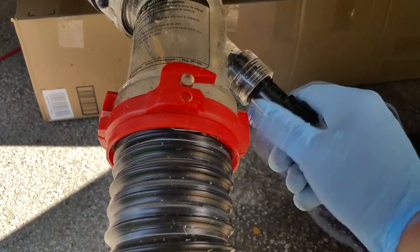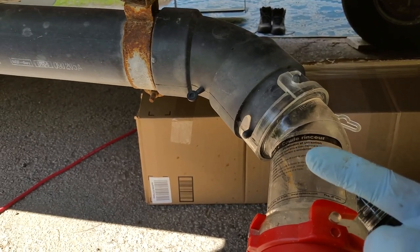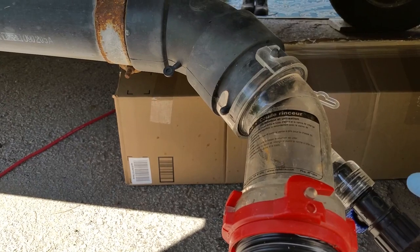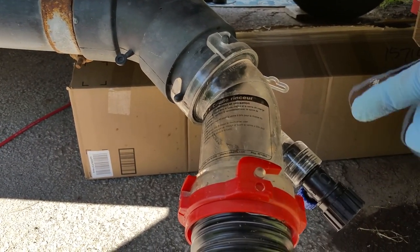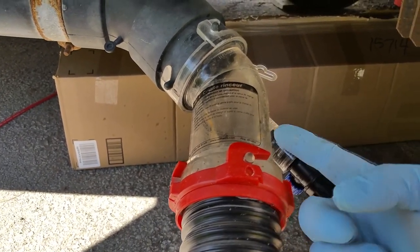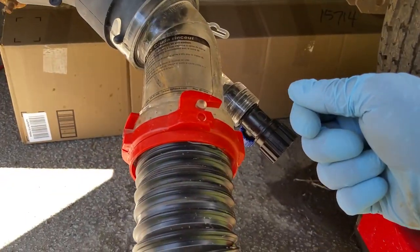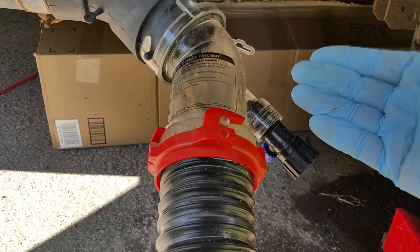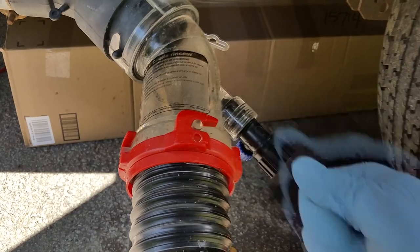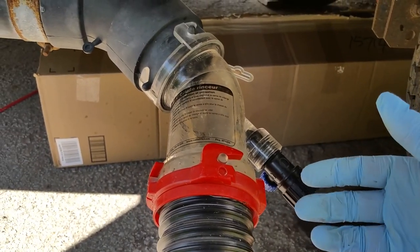Then this just comes out — you drill up there, push the snake up. I had to go around a couple of bends, as you would in all fifth wheels with the toilet mounted up in the front. In other trailers, the black water tank is typically right below the toilet, which makes this process easier. I had to twist the snake a couple times to get around corners. Once I thought I was in the tank — you have to sort of do that by feel or measure how many feet back — I would just push the snake in and out without twisting, because I was afraid it might get knotted up and not come back out.